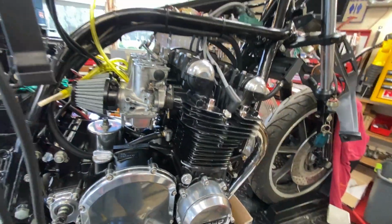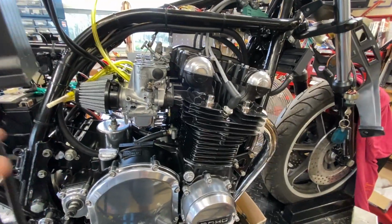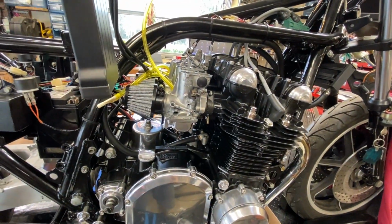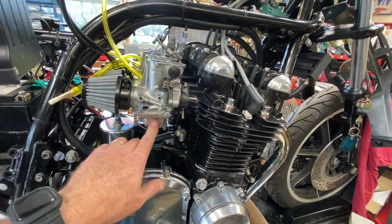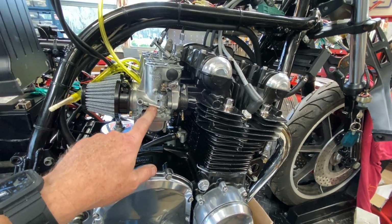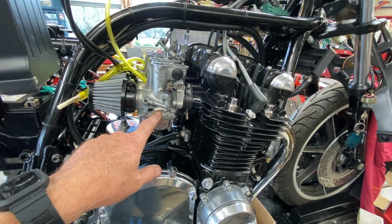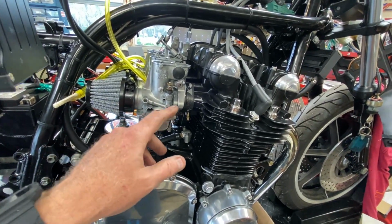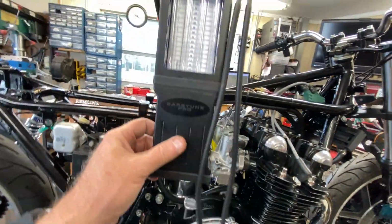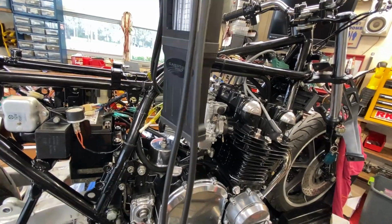I made sure it wasn't overheating. I've been shooting it with the laser and got the fan on it, and she's been okay. I suspect that the float level is off. I don't think it's too low, I think it's too high. That's my gut feeling. So it's over fueling on the rich side, and it's bogging it down. As far as the pulses on the carb tune, I'm not 100% sure why that's doing that.